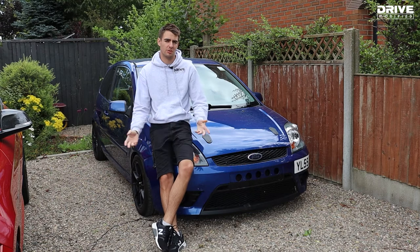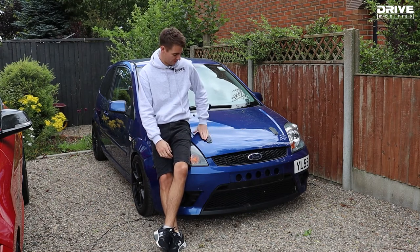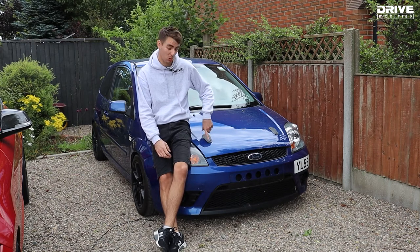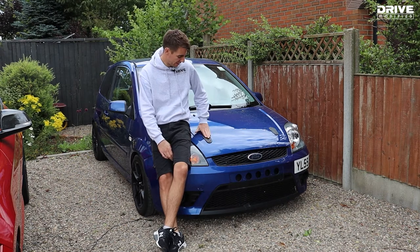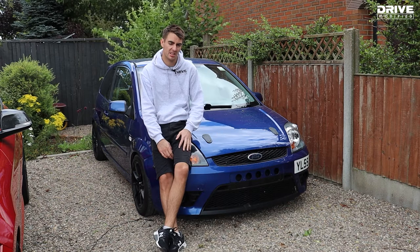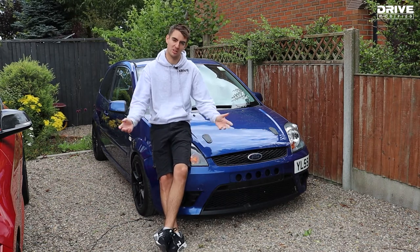So that was a very rough guide as to how to fit bonnet latches. I slightly messed up the left-hand side one because I made the hole slightly bigger than I should have, but no biggie — it's still got all the bolts holding the latch in and the pin works nicely, operates nicely, and crucially holds the bonnet shut, which is obviously what you want it to do.